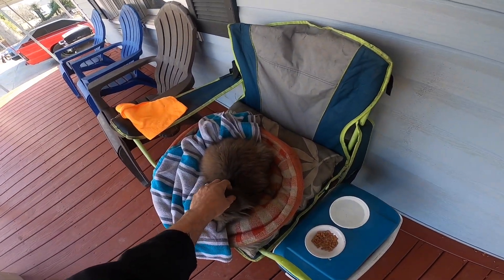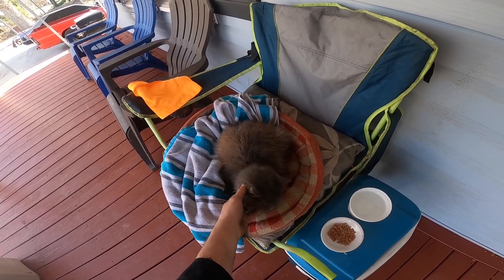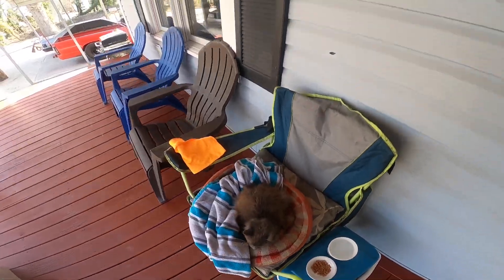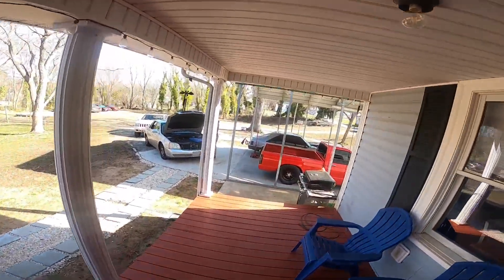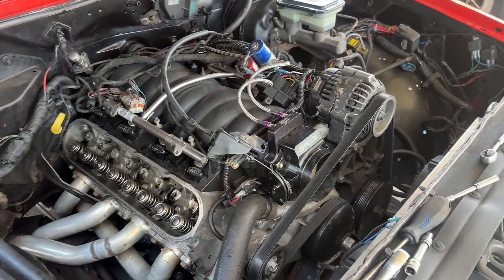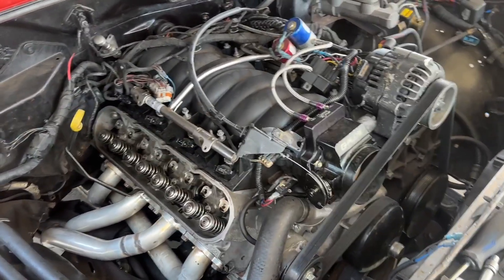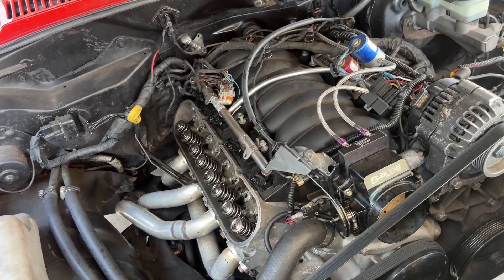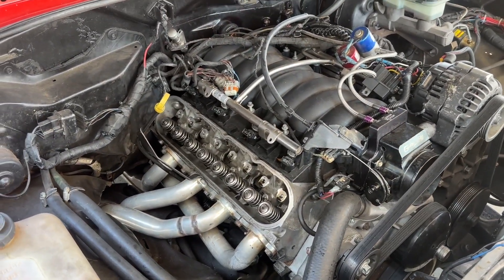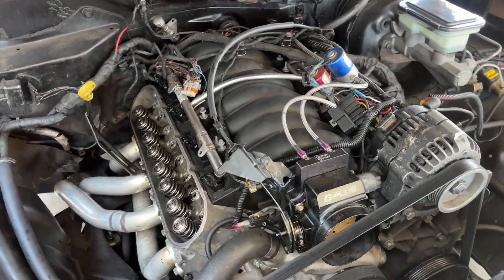Hey Smokey, you getting old, ain't you? Today's the day we get his head yanked off. Got the oil drain there, any change there. Get everything ready - I'm gonna CC these heads, compare them to the other heads, make them the same. We'll put the head back on, so let's get these heads off. That wasn't CC'd - figured out what we need to do.